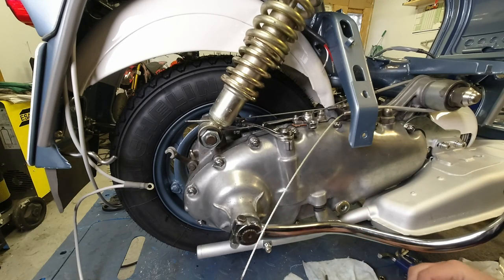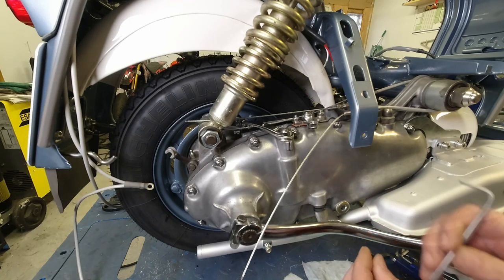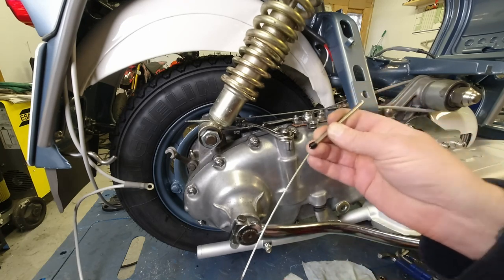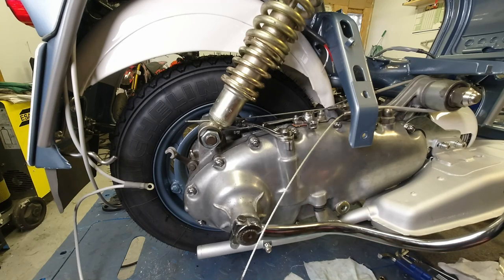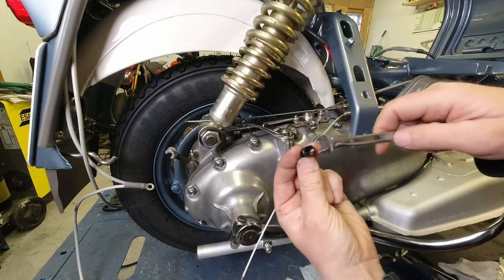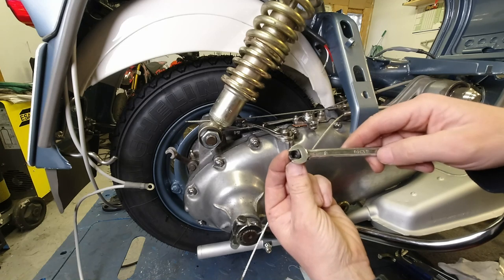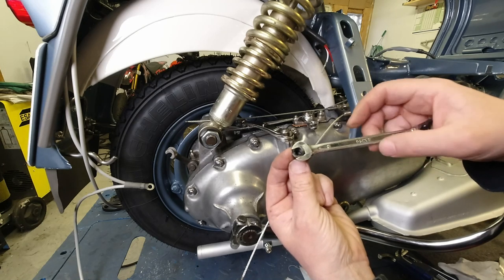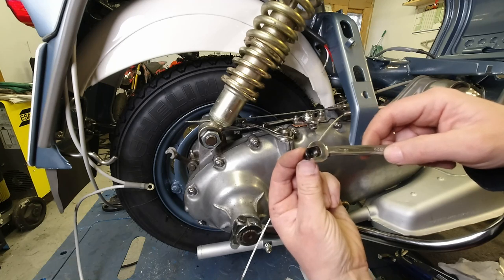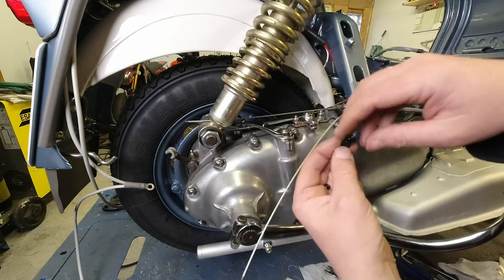And another handy thing is that on the SIP one, it is a 4mm hex key, which is also a normal size, which you'll get in normal Allen key sets. And incidentally, the flats there fit a 10mm spanner. And a 10mm spanner is something we've always got in our toolkit. So that's really handy if you're going to need to change cables along the road. So let's give this a go, see how it works.